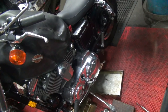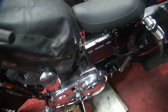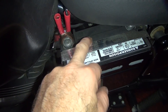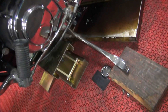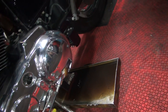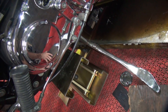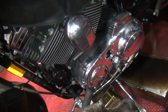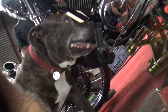Half a turn there — you're supposed to run it right? The paint is fine but sometimes I got to work on it. Right now I got to put a new front tire on. So now we have our eighth of an inch of free play right here — that's the free play, you don't have to pull hard on it. So that's how you do that. We'll ride the bike and see where it lets out. If it lets out too close to the handlebar, give it more free play. If you have to pull it all the way in to make it release, take out some free play. Ideally I want it to pop out about right here as we start going.